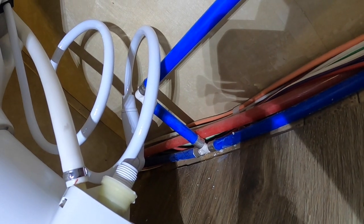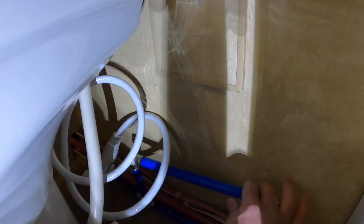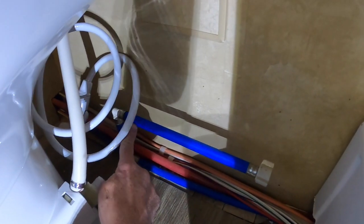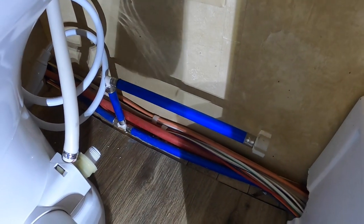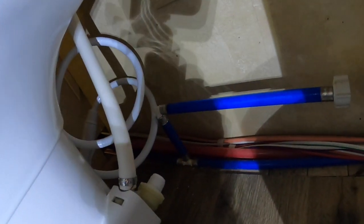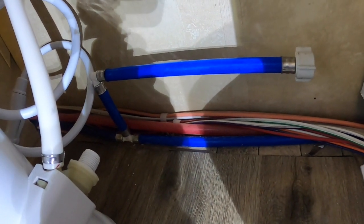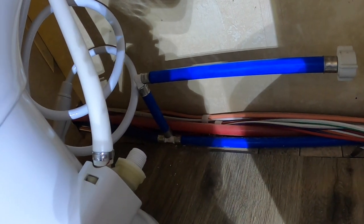The next item is connecting my existing water line, which was different. The other toilet had a connection up at the top; this one comes in straight at the back. So I'm going to cut this and put a SharkBite elbow connector in. I also want to add a shutoff valve because I've read online that on some of these Dometics the valve starts leaking after a while on the foot pedal, so I want to be able to isolate the toilet. I'll see if I can get a ball valve in here.